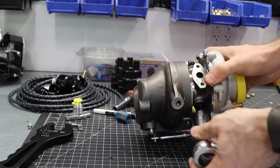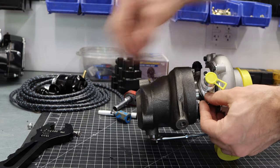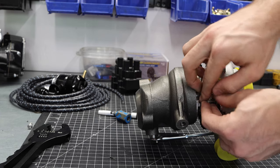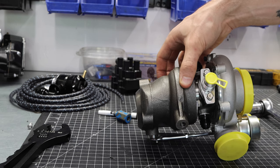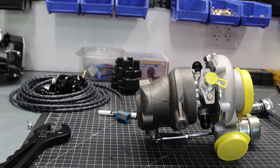I'm tightening these down now. I did use a thread sealant on this — it needs to be high-temp because this whole side gets really hot. Then we have our turbo oil drain. For a turbo oil drain you want the largest fitting that is reasonable, because you don't want any restrictions on it — any restriction is going to cause problems for the oiling and lubrication of your turbo. The drain itself uses gravity to drain oil out; there's a pressure feed on top with a much smaller hole that feeds oil in to keep everything lubricated. On this bottom end you want to open it up and allow as much oil as possible to fall back into the sump. I've got a 10-AN fitting here, which is nice and big.